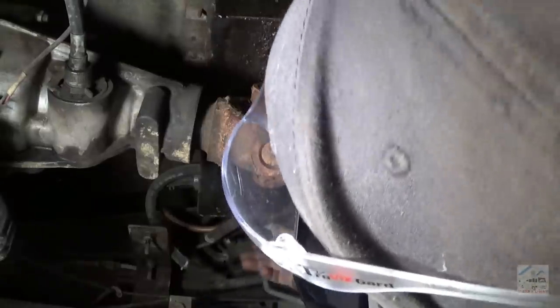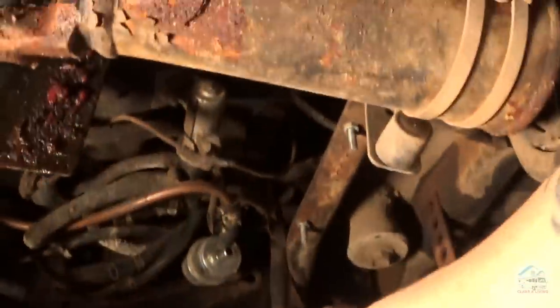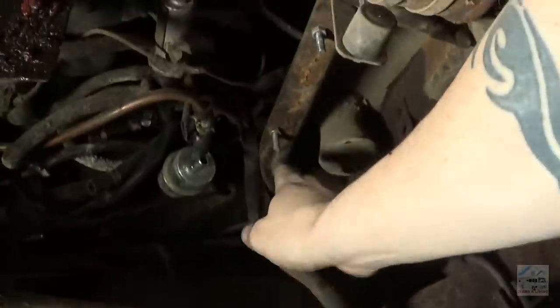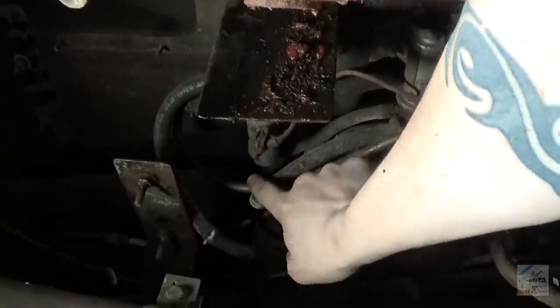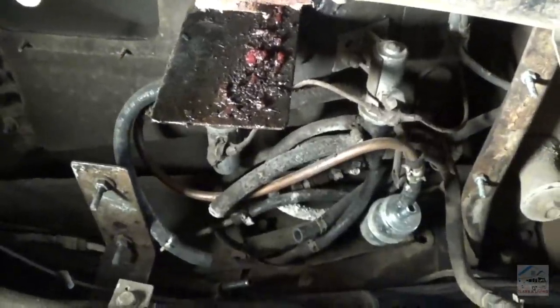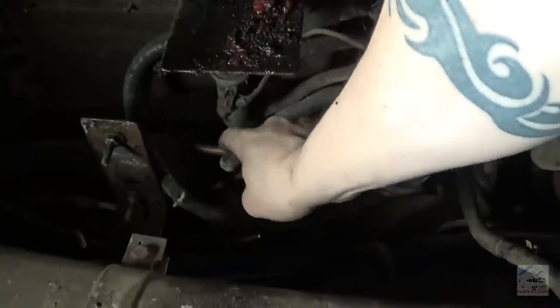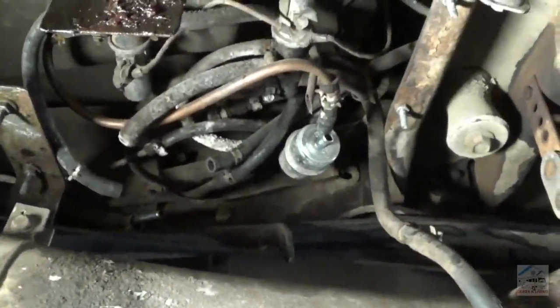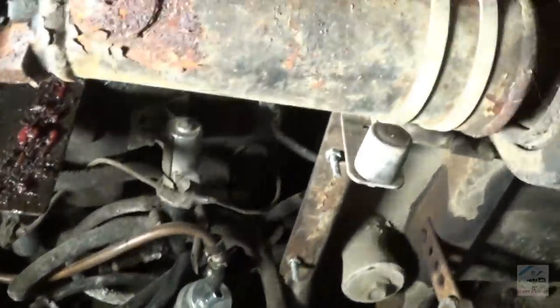But I think this is a line to the back tank and that's not letting anything through. Yeah, that is totally sealed up. Alright, I'm blowing air backward through the valve system, just seeing if that all cleared out, and I can feel a jet of air coming out through this spot right here. Got another split line. I can feel a little air coming out of there, and then I can notice there's a big jet of air coming out that split. So another bad fuel line. I think I'm going to take this one off and just bypass that for now, because you got to replace all the fuel line down here.